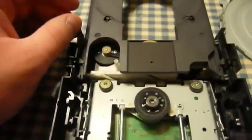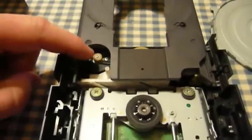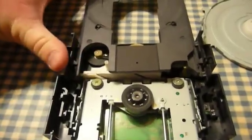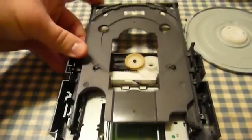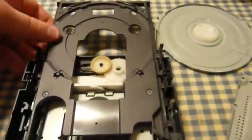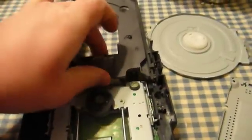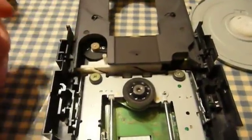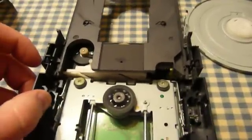If your drive is having an attitude problem with the tray, you can fix that problem while you're in here as well, because right there is the tray motor that runs the tray in and out. You can kind of see where the belt is and the gear train that makes all that happen, and the little switch that tells the microcontroller if the tray is open or shut — that belt can typically be replaced by a piece of O-ring or a simple rubber band.